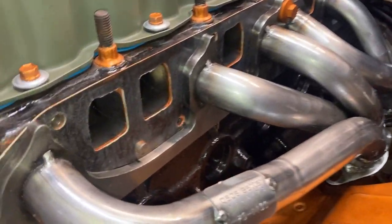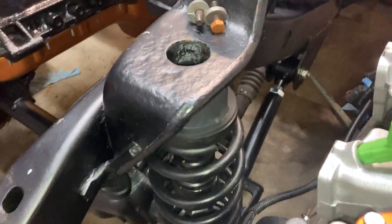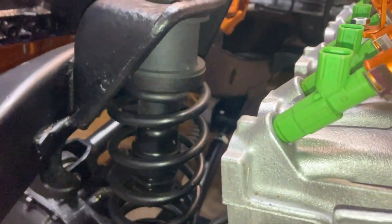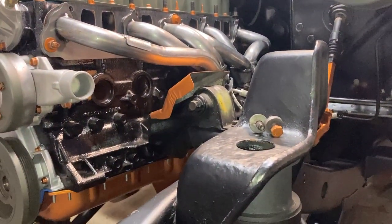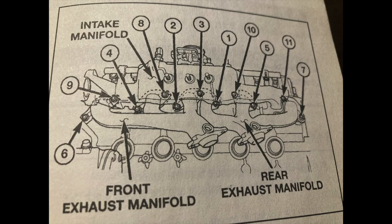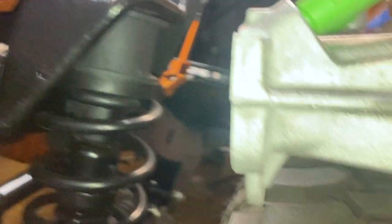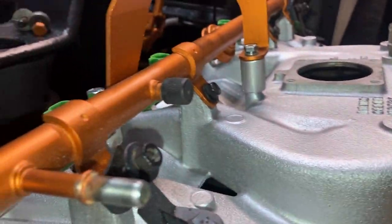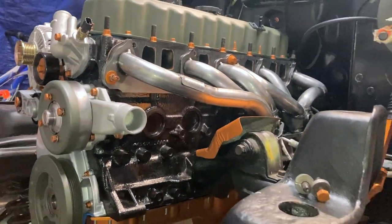I have that on there right now. I kind of screwed up because I should have made this part of the video earlier — I need to get that manifold on there to tighten in the correct sequence. There is a special sequence to tighten the manifold and header; I'm going to put a picture of it on screen right now. Okay, that sequence was for 2000 and above.